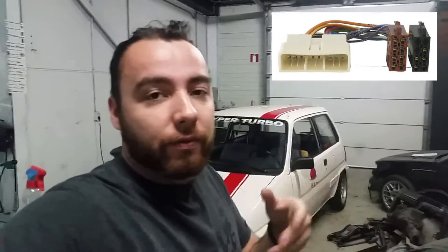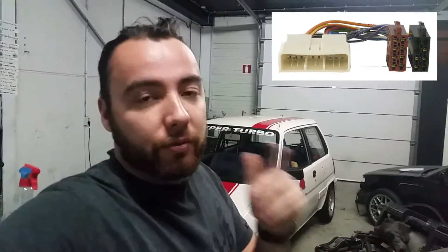The problem is with the radio currently is that it doesn't work. There's a radio in it but the wiring is all messed up and I have to redo everything. There used to be an original plug in it, and usually people just get a conversion plug to convert from the original to an ISO plug, but the previous owner messed it up — they soldered everything together and now it's a big mess. It ends up with two ISO plugs.